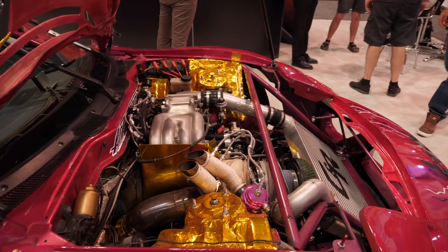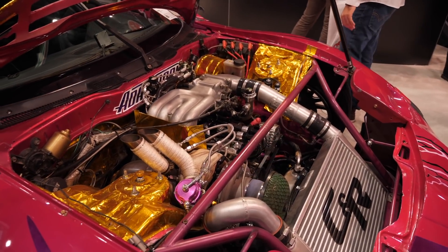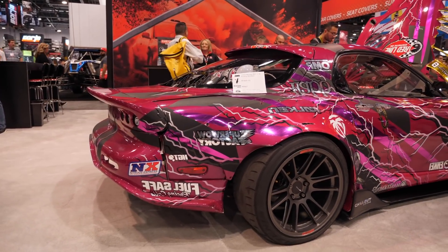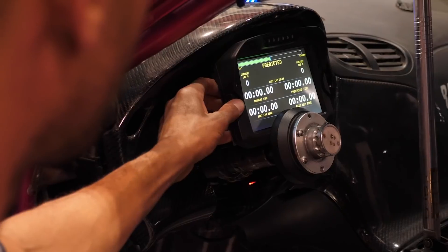In terms of internal components, there's a huge variation between the piston engine building world and the rotary engine building world. There's a huge range of aftermarket components for piston engines, but not so much for rotary internals. The build is running Mazda rotors — all Series 6. A lot of people mix those up, but it's kept with the S6 block. The only aftermarket internal component is the apex seals, which are PTS seals.